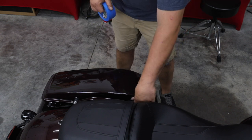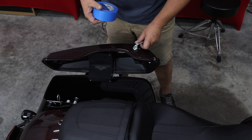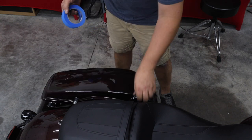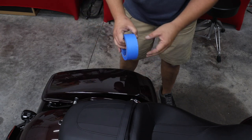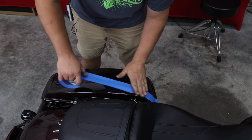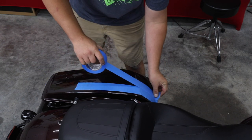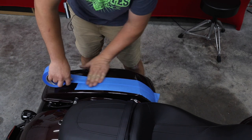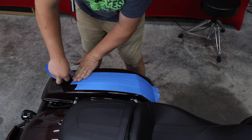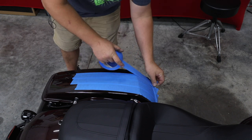So the first step: look inside your bag and make sure there's nothing in there that you're going to get dirty or damaged in the process of cutting and putting this on your lid. Close it and latch it back. Take a roll of masking tape and mask off the top of the lid — this is just going to protect the lid from any possible scratches. Our template's going to do the same thing, but we're really just keeping the vibration of our saw from making our template scratch our lid or our paint. This doesn't have to be perfect, but if you can keep it from having a bunch of humps in it, it is going to make your template lay down a little bit better.